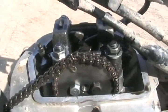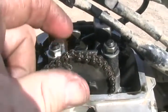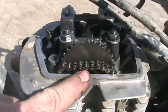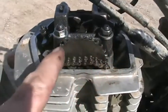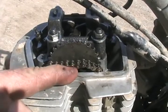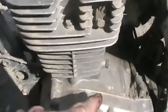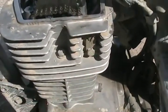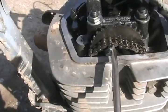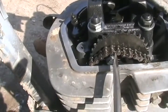Be careful not to drop either end down the hole. Get that arm swung over to get back on that pin again, then squeeze them together with pliers. Now the chain is put back together - it just has to be squeezed. To get it back on the sprocket I have to undo the two bolts, drop the sprocket down, hook the chain on, set timing, lift it up, put the bolts back in, and then adjust the lash adjuster. With the screwdriver just pressed against that little figure-eight link, I tapped the back of the screwdriver with the hammer and it pressed the pin all the way back in.